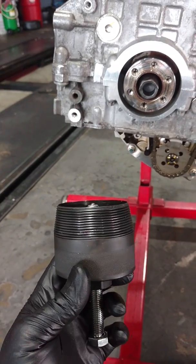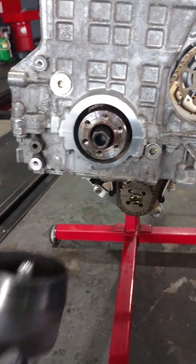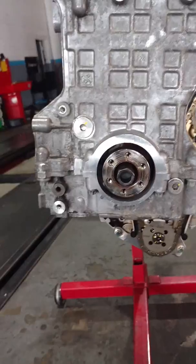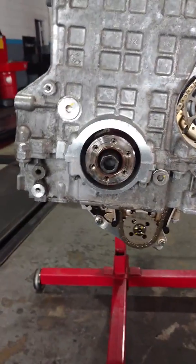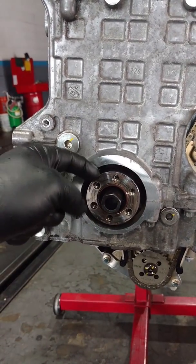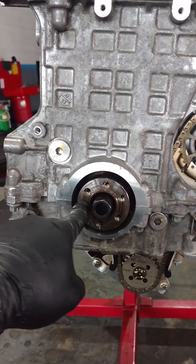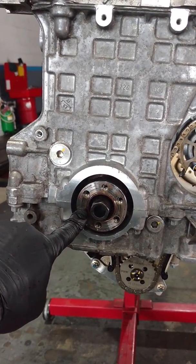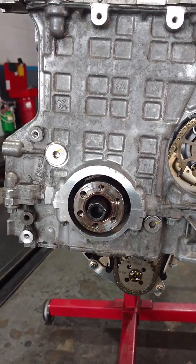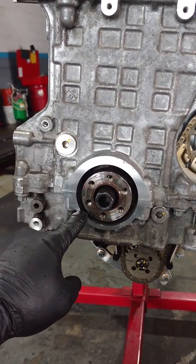We have this tool — essentially it's just a really big screw. You screw it in and it bites into the seal and removes it. If you don't use something of that sort, you can damage this aluminum — you can damage the seal surface on this crank hub. If you watched our other video on how hard it is for this to come out, which also involves timing. If you damage this crank seal riding surface, you're going to have another leak on your new seal. If you damage the outside diameter or don't seal it correctly, you're going to have a leaking crank seal.